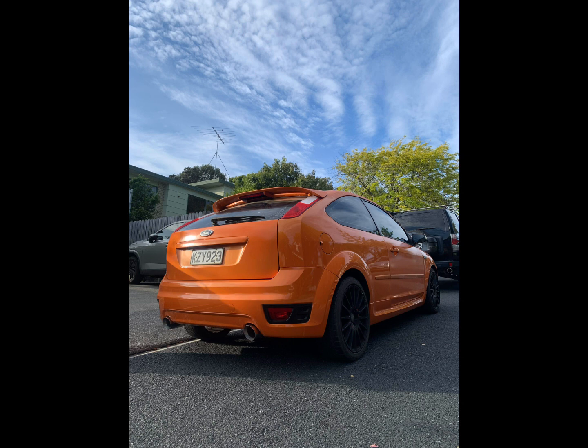On the first drive, I just went on a small drive, let it come all the way up to temp and then back down. And I didn't boost it at all because I just wanted to go slow for the first one. I took it on about 3 or 4 of those smaller test drives. Then I took it out, easing on the boost, so just doing half throttle pulls, then 3/4 throttle pulls, until finally I was doing some full throttle pulls. Whilst I was doing this, I was constantly pulling over, checking for any leaks under the engine, checking everything's still plugged in, keeping an eye on my oil temp and oil pressure gauges, and just generally looking over the car, making sure everything's good.